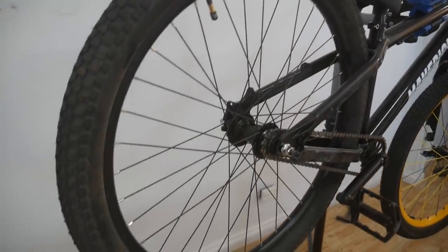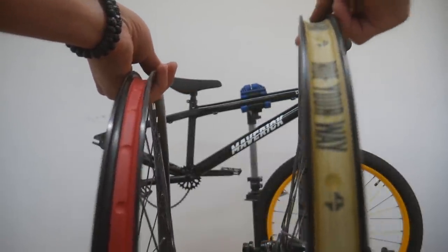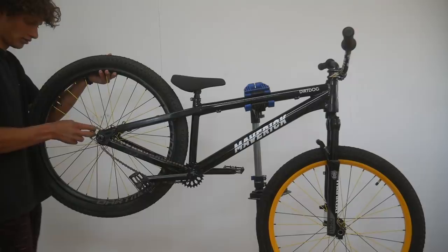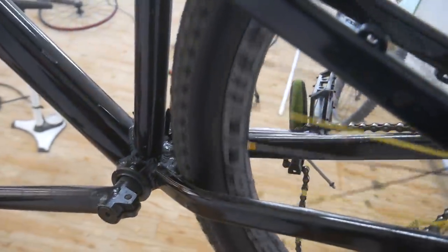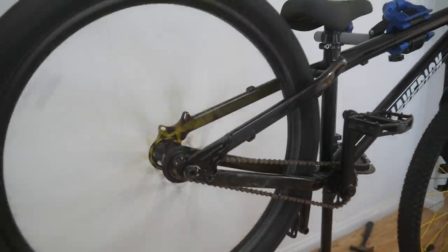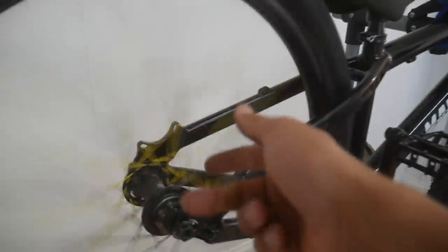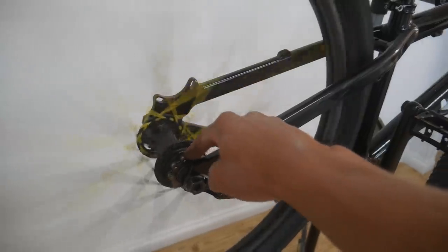I'm going to be swapping this back wheel out still because my other one's just a lot better. Look at the difference in the thickness — and this wheel is still wider. With the wider rim and the 2.3 inch tire, all the way slammed, it hits against the frame. So I'll just shorten the chain. There we go, that sounds a bit better — it spins way longer. This hub's really four years old and it's still pretty neat, only the teeth on the pawls there are worn out.